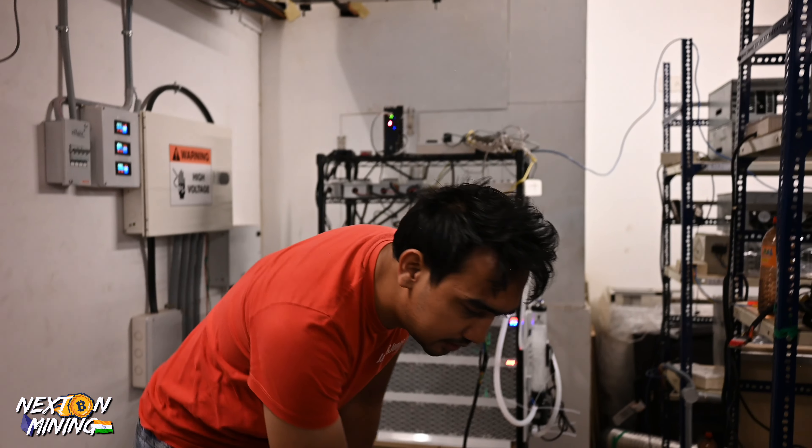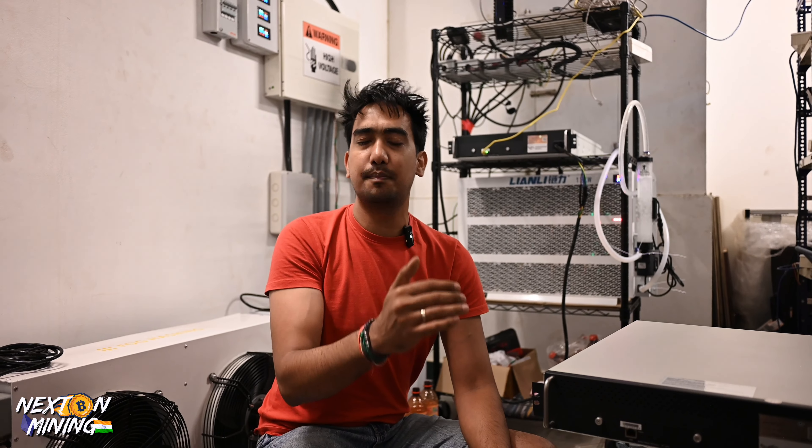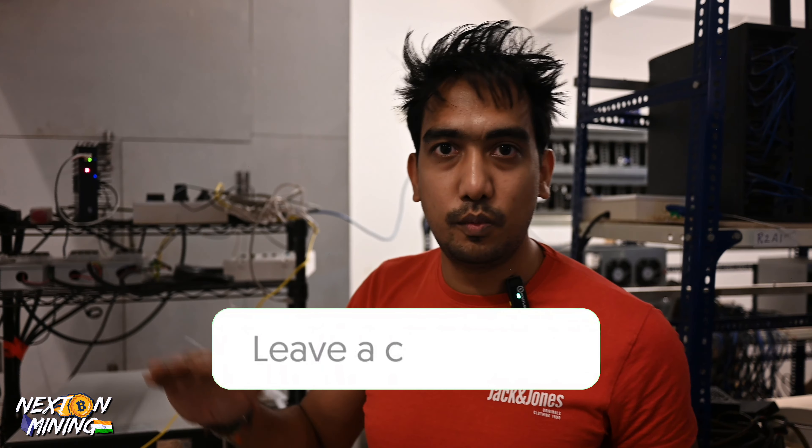This miner has one more mode — you can overclock it. If you have 240 terahash, you can overclock to 280 terahash, though power consumption will be a little higher. We are testing this series compared to the S19 Hydro. One thing to note is that its temperature range is about 5 degrees higher — so if you set a cut-off at 40 degrees, it will run at 45 to 50 degrees. This is one advantage.